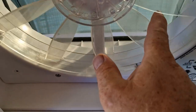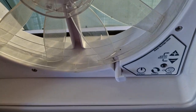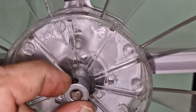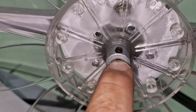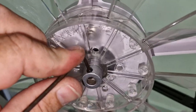So that's them out and that will just drop down out the way. I'm going to take this part of the fan off because I wiped one of the blades - and it's not clean either. I'll give around the inside of here a wipe, take that out and try and clean up what I can see above as well, because looking in the back of there - that was disgusting. The next part of the job is to remove this little grub screw here - back it off just a tiny little bit. That's a 2.5 millimeter allen key, and you can see on the side of the shaft there's a little flat spot that sits up against it.